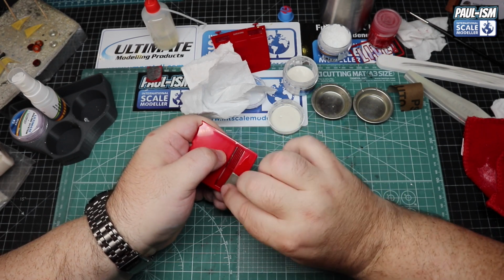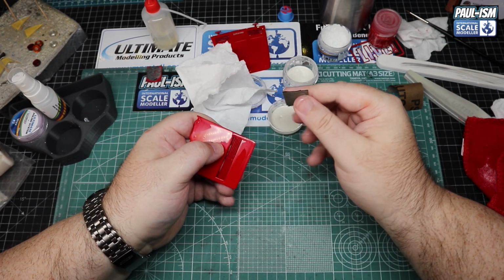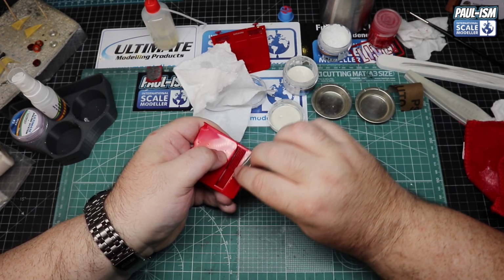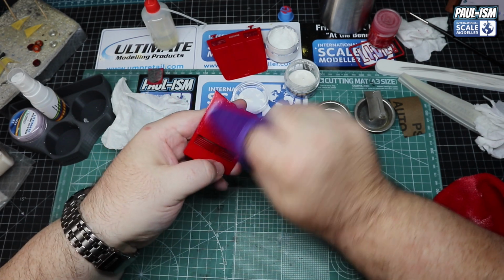But it's just by the by. But just on that front luggage compartment cover, you can see spots where dust had been, and that's what we're trying to minimise the look of. So some water, some wet and dry, and then the UMP compound and polish does help reduce it significantly.